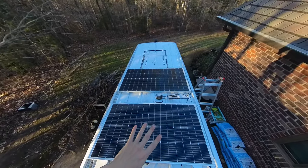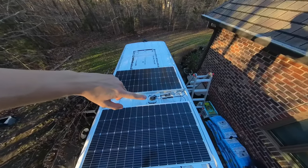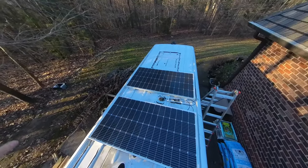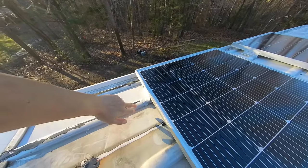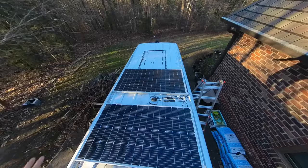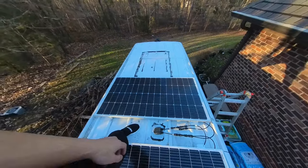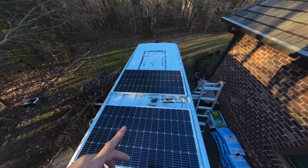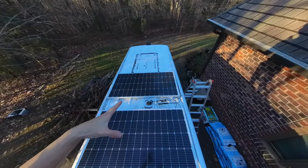It's been about 24 to 48 hours since the last video. The install happened, I added a junction box, and connected the lines for the two solar panels together. It rained yesterday, which is why I waited a full 24 hours, also to let the sealant stay in place. Everything passed the water check — no water down there. The JB Weld did a perfect job sealing all the old holes with no leaks, and I added a bunch of self-leveling lap sealant with no water leakage there either. That was a really easy way to install the solar panels and feed the wire through. Next I'm going to finish the ceiling installation — halfway through the van the ceiling is already done.